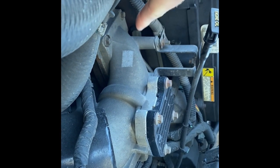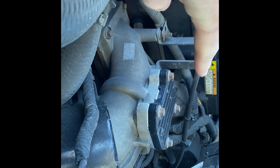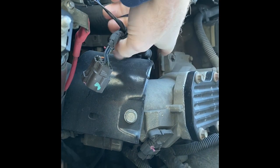There's a bracket right there, another bracket there, two on the outside, one on the back, two on the other side, and I assume that bolt right there is for that. Then there's a wiring harness that runs here — they all look like 10mm — and I've got to unclip it right here for the sensor. Other than that, I feel like that's it.